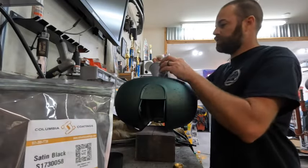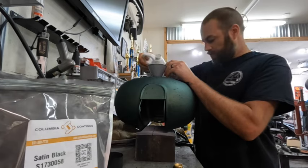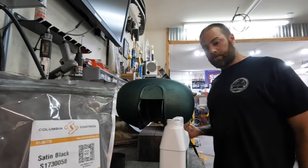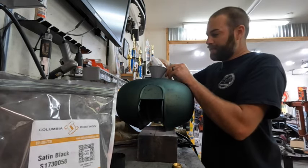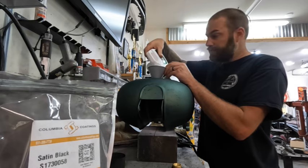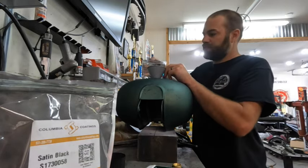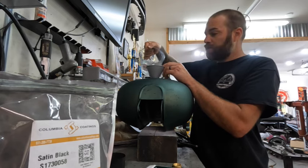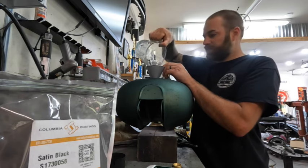We've got ourselves a funnel. You do want to protect your painted surfaces — this is just a cleaner degreaser so there's nothing that would damage the paint yet. I didn't plug the petcock on the bottom — I had it open because we just drained the tank of water — but now that we're doing the cleaner degreaser, we don't want it to drain out. We're going to pour our quart of cleaner degreaser from the POR-15 into the tank. We're not putting anything in the tank with it since our tank is not all crusty inside — we're just doing this as a precautionary thing. In goes the quart of warm water. Then we put the cap on and start rotating, rolling, and shaking this thing fairly continuously for the next half hour.